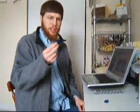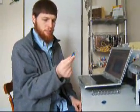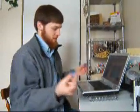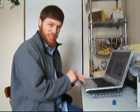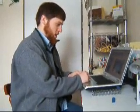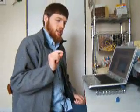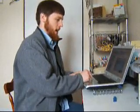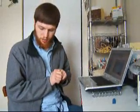To be able to communicate to the Firefly from your computer, you need to have a Bluetooth adapter, some way to speak Bluetooth on your computer. So I have this thing. It's called Bluetooth, apparently. It's generic. Well, it fits into your USB port. And then I right-click on it and say refresh services. It sees the Firefly, tells that it supports the serial Bluetooth protocol, and I connect to it. Now my computer currently believes it has a serial cable connected to the Roomba.